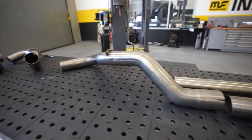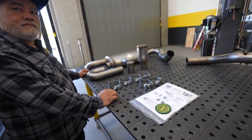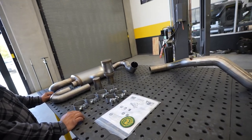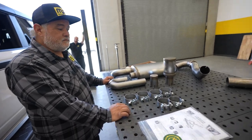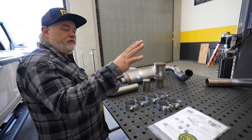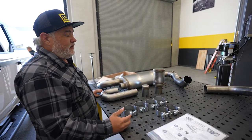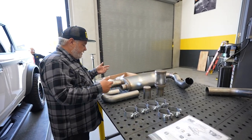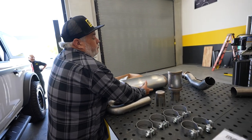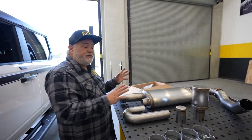We've got everything laid out here — the full exhaust. Richard was going over the tunability features for the user regarding drone. With a car like this, if people upgrade wheels the sound changes, so there are different adjustability options. Richard explains: first and foremost they wanted maximum performance increase, going from a two-and-a-half-inch factory exhaust to a mandrel-bent stainless three-inch, so you have the most airflow to support any future engine tuning. The mufflers have no restrictions — it's a straight-through shot.